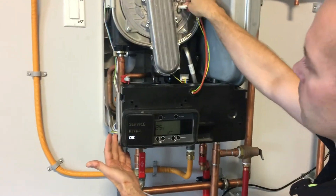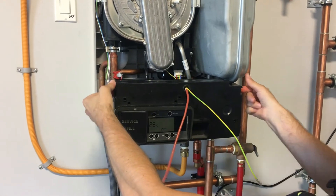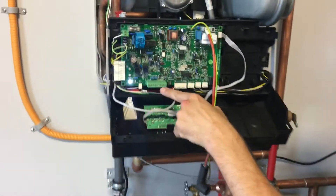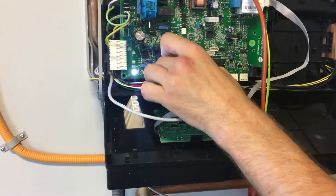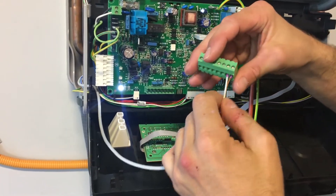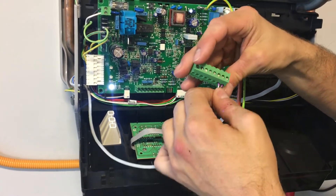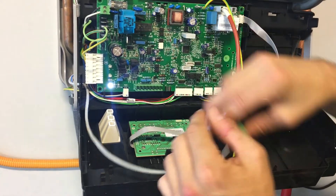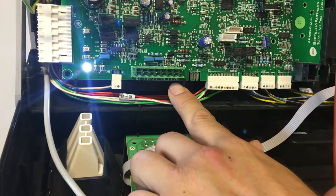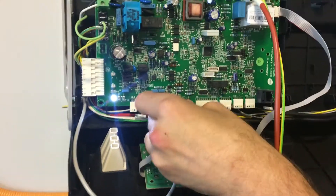Take off one wire, two wires. On the side are two latches — push those in and this folds down. Now we have our wiring strip right here. If I take this off, you'll see our tank sensor, which is a 10,000 ohm resistor or sensor, connected onto the two far right ports. If you zoom in right there, you will see it says 'tank' — that is where you wire in the sensor. So let's put that back on.